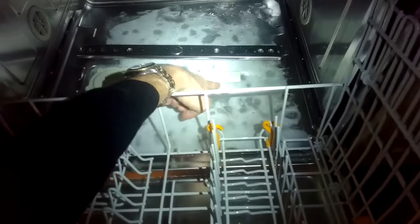I'm gradually pushing the dishwasher back into the cabinet to get it nice and flush. We're going to check to see how the water level is now that we've been running it for a little bit. It stopped filling, so I'll pull the basket out — it should be just kissing the bottom of the white plastic filter handle. Yeah, right there. That's perfect, that's exactly the right amount of water. When these fill valves aren't working they'll tend to let in more than that, and that'll either flood the drip pan below the dishwasher or cause water to actually leak out onto the floor, which happened in this case.